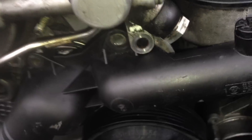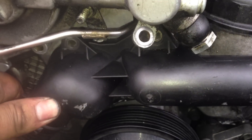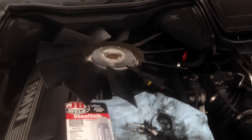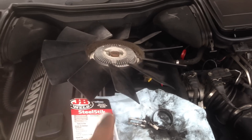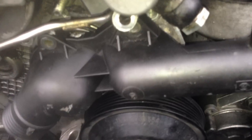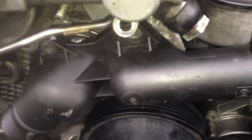That's how easy it is to take off the thermostat housing — it's real easy. If you watch my other videos, I'll show you how to take off the fan shield, the fan, and the fan clutch — right there — to get to this part. It's very easy, and then you just unscrew the hoses on both sides and it comes right off.